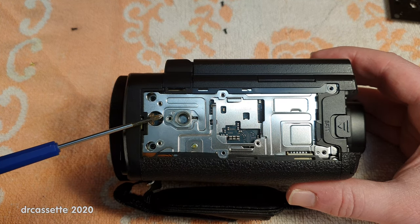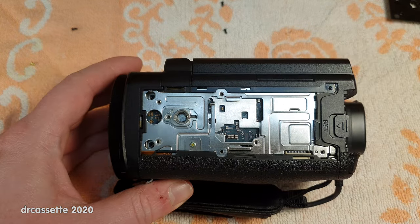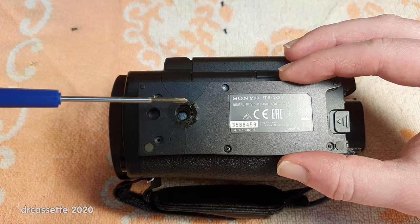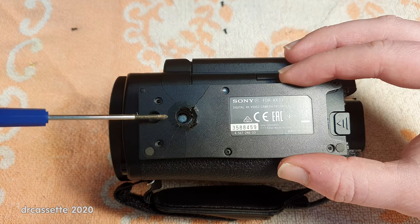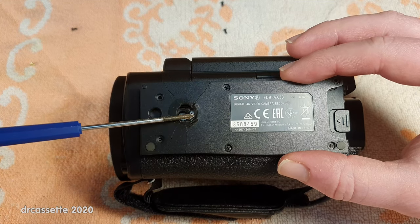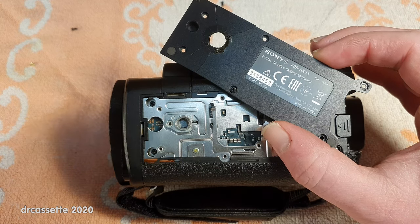If you only have the tiny little screw in that position holding the tripod mount in place, basically a lot of the stress is going primarily in this direction, because that right here is where the screw is. So the stress is right there, and you can't rely on this piece of plastic to take the stress of the tripod mount being pulled out of the camcorder, because it's not held in place properly.